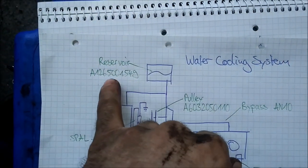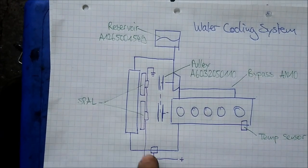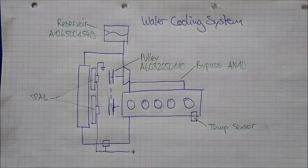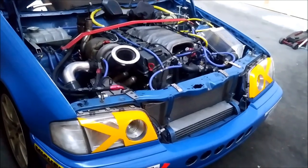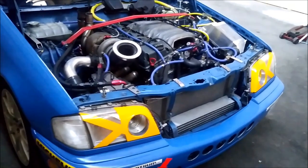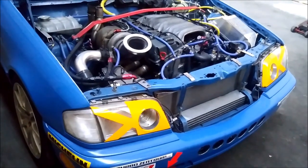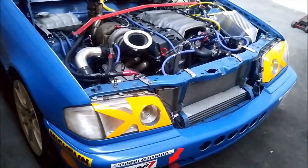I have a reservoir — I used one from a Mercedes model. I have some electrical fans from SPAL, switched on with a temperature switch, so at a certain temperature they switch on and off again. The cooling system is a very crucial system from my perspective. I know people often don't understand why I have such big cooling problems when I tell them my engine is getting hot — they drive higher horsepower numbers and don't have cooling problems. But it depends on how you use it. Normally those engines are built for highway use, for daily use — they get a few pulls and then it's back to driving slow, so the engine has time to get rid of the extra heat.